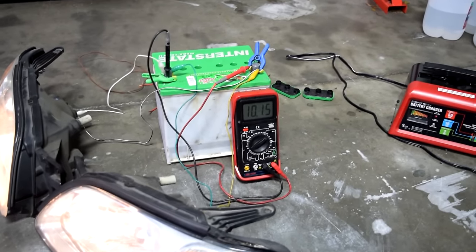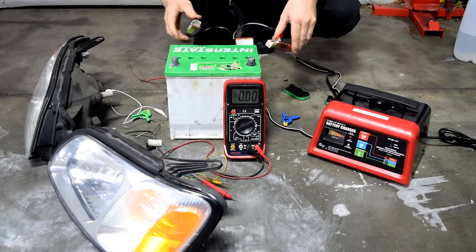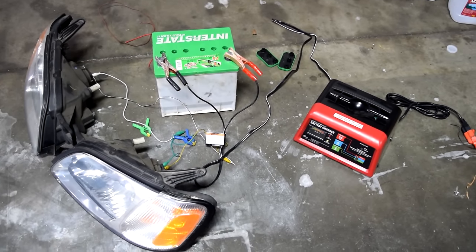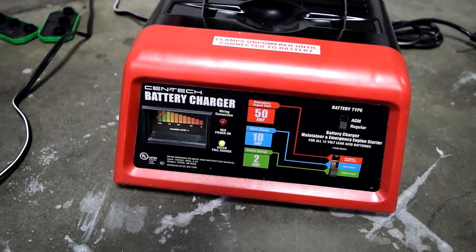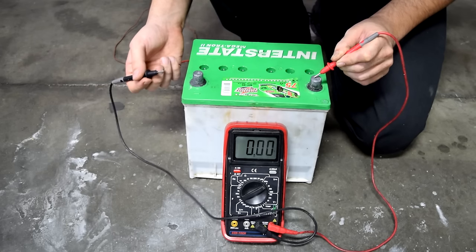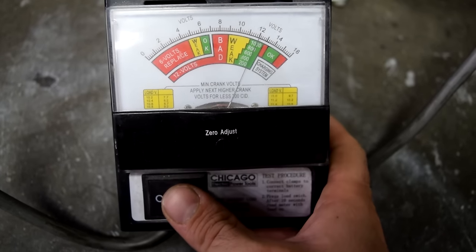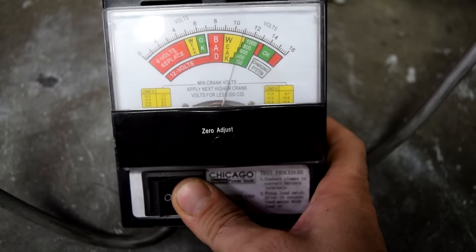It's been a good few hours and we're actually down to closer to 10 volts, but it's okay. We'll take these headlights off and reattach the battery charger. We're going to charge this for about 24 hours again, or until we get a green light saying our battery is fully charged. It's been about 10 hours this time and I believe we're done — the dial is at 100% and we have a green light telling us the battery is fully charged. We've got a bit of an overflow issue again, so let's clean that up. Now we've got 12.66 volts, which is right on target at about 12.6 volts. Now here's the real test — our load tester showing us how many cranking amps this thing can put out.